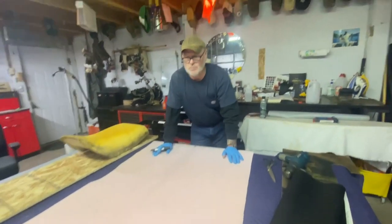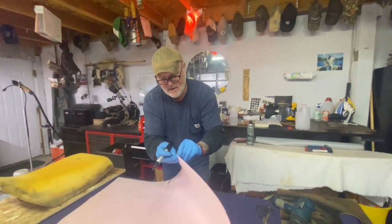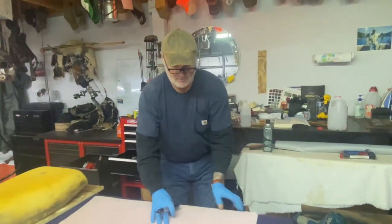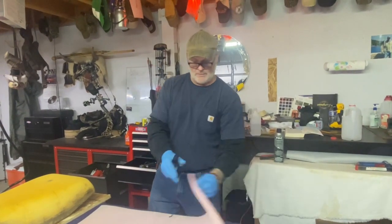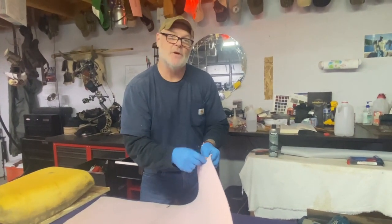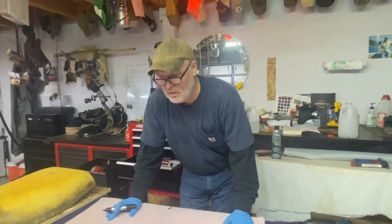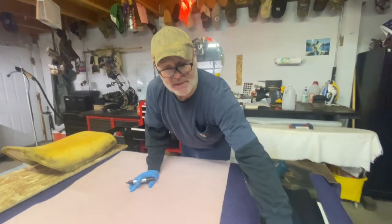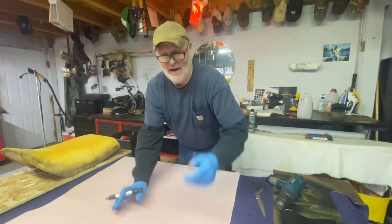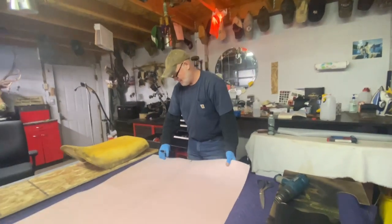Okay, now, this is where some people would go, does the mesh, see that mesh that's on the very top of that? I'll pull that apart. You see that little mesh? That's what scrim is. So when you're sewing, you always sew with that mesh down. Then your vinyl's on top and you sew through that, your hook and loop comes through there, and this prevents your stitch from popping back through and failing on you and ruining your whole piece. That's the whole premise behind scrim. But I like it because of its durability factor. It just makes sense, doesn't it? Think about it.